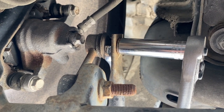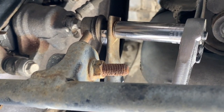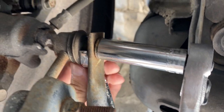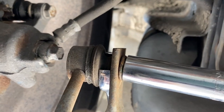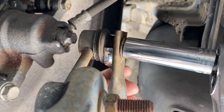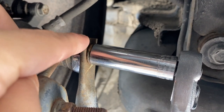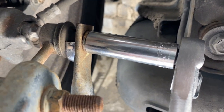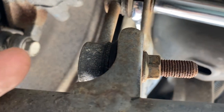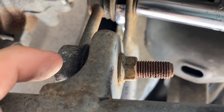The end links are not coming off nicely. What I had to do was use a regular 14mm wrench on one side and a 14mm socket on the other, because the whole piece just starts to spin. There are only about two flat spots on the end link, so if you get it just right you can hold it with the wrench while you turn the socket. The second side might be a bit more of a problem.